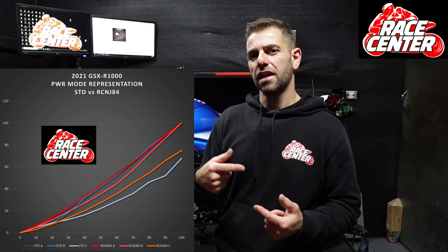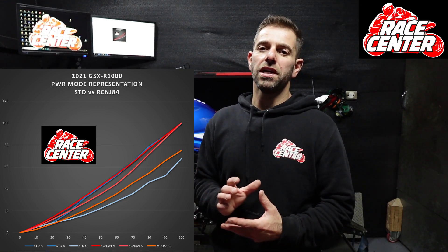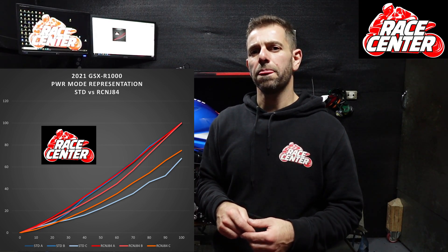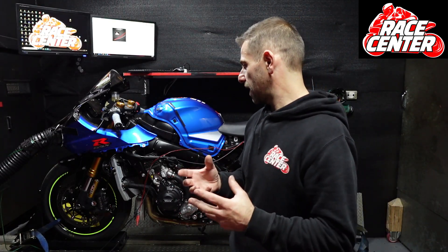In the standard mode between A and B, there's not a lot of difference other than the initial throttle on B being slower. And then on C it's quite different — the C is almost like a different motorbike. The reason we put our own throttle maps or power maps in is because it gives you a better choice between A, B and C — they just make more sense. Your B is still full power mode but for maybe an intermediate rider. Your A would be for a more experienced rider or racer. And C mode would be for a more novice rider at track days on their 1000, and also a great wet mode. So we give you three modes, and that's the part we call the remap.